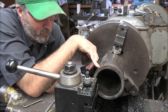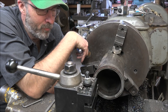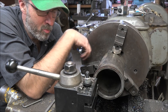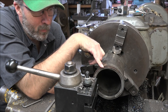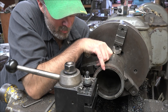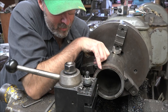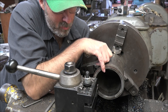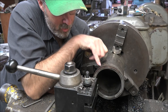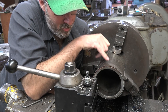This, if you notice, is a very thick cylinder liner. It's used in a tractor pulling application to de-cube an engine — to decrease bore size. So these are special, real thick, made to run a smaller piston. But when they made it, the liner is flat on top. The standard liner has a fire dam that is a piece of iron that sticks up higher to help protect everything gasket-wise. It helps to deflect some of the flame front back into the chamber, so it takes some heat off of this. Well, they didn't do these this way when they made them originally.